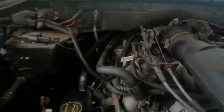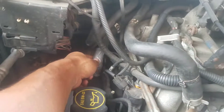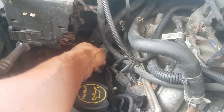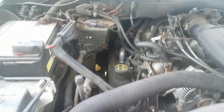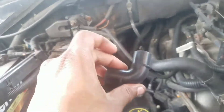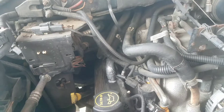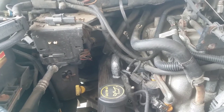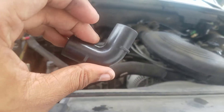Those codes are basically related to a possible vacuum leak in your system, which is most likely coming out of these hoses right here. As you can see, I got duct tape here to temporarily cover the dry rot, cracks, or holes coming out of this vacuum hose. I actually had to order a brand new one from eBay because Pep Boys, AutoZone, Advance Auto, or even NAPA didn't have these parts in stock. I ordered two of them — it was ten bucks.